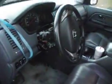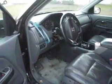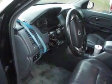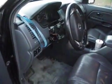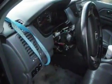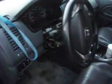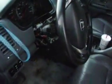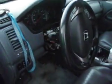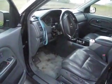But once you put the used ignition in, your car will not start because the ignition needs to be paired with the ECU. So you're going to have to take your car to a Honda dealership. That's the other sucky part about doing it this way. Hopefully you have AAA to be able to tow it to a Honda dealership. The dealership charged me a half-hour labor, $62, to program the ignition. So I paid $60 for the ignition, $62 to have Honda program it, and voila, for $120 I put my own ignition in. Way better than the $650 Honda wanted or the $400 the locksmith wanted.